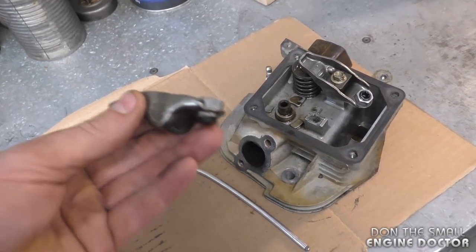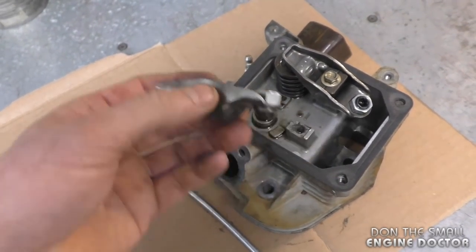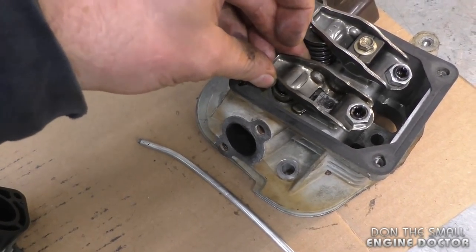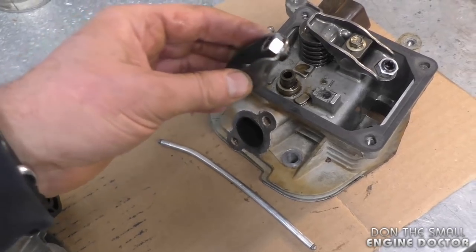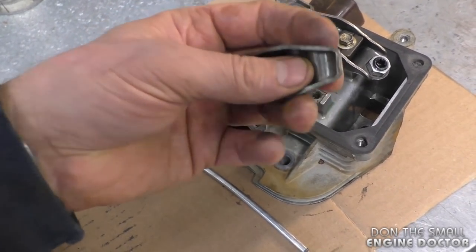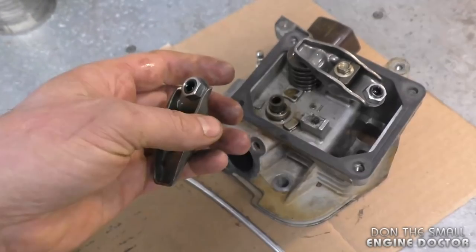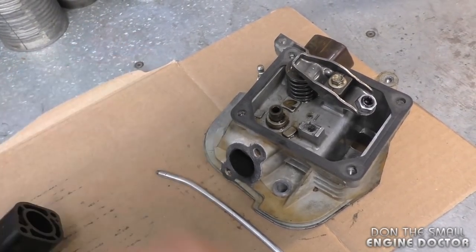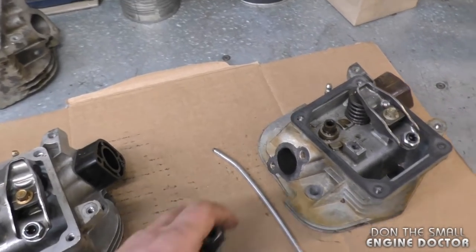What I think is happening here, guys, is because the valve guide pops out, somehow the rocker arm doesn't work quite as well as it should. It's not able to go all the way down, and in turn, I think it's bending the push rod. And usually the push rod will pop off the back of the rocker arm so that the valve is always shut, and that's why you're not able to pull your engine over even with the electric starter. So it kind of simulates as if it were hydrolocked.